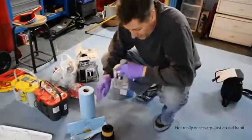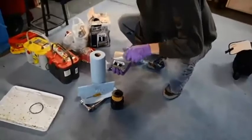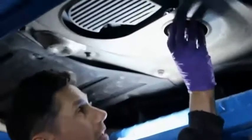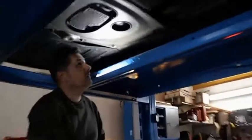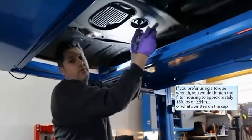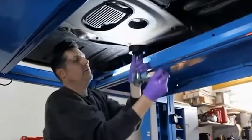One thing I like to do when I'm changing the oil — I have the new filter in — I'll go ahead and pour a little bit of oil into the filter. This is kind of a quasi-priming so that when the engine starts initially and the oil pump starts sucking oil from the filter area, it's not completely dry. When putting the oil filter back in, guide it up into the hole and tighten it by hand initially until you can't tighten it anymore. Then use the oil filter wrench to complete tightening. When I say tightening, I don't mean getting down on it and getting it really tight. Just go thumb tight until you feel you're at an end — just your thumb, and you're done.